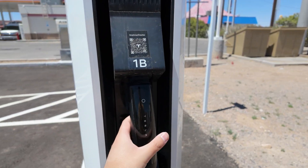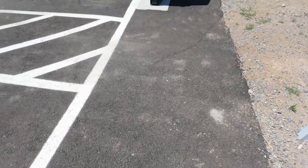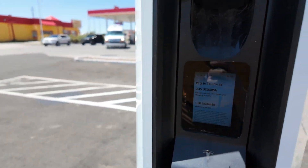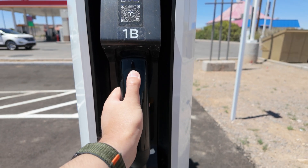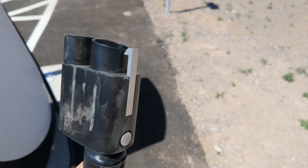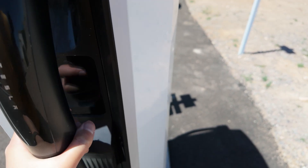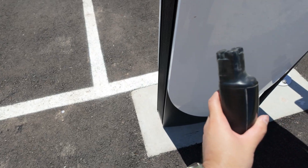They have a very long cord — about 2 meters, 6 feet. If you have a Tesla or other NACS vehicle, like the future Kia EV6 or current Hyundai IONIQ 5 2025 model, it's just a long cord. If you have a non-NACS vehicle, you want to use your own adapter, but they all have a built-in adapter — that's what they call the Magic Dock. Press this button for 2 seconds, you'll hear an electronic click, push it up and it'll unlatch, and there's the Magic Dock. Just like the Tesla Gen 3 wall connectors, it's electronically locked so no one can steal it. Plug into your vehicle, and once you're done, unplug and put it back up to latch in. Then Teslas or other NACS vehicles can use the post as normal. It supports 1,000 volts whenever the cabinets have 1,000-volt support.